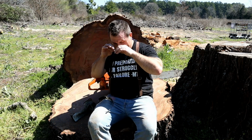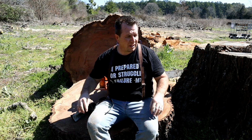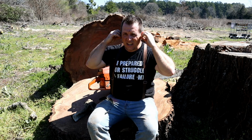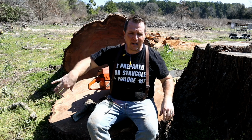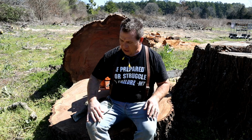Too much sweat. Can't see nothing. Oh boy. Well, I figured it out. It was just a little too rich on that low jet, and when I would come down off of full throttle, it would load up. What gave it away was the black smoke chugging out of the thing where it was flooding out.